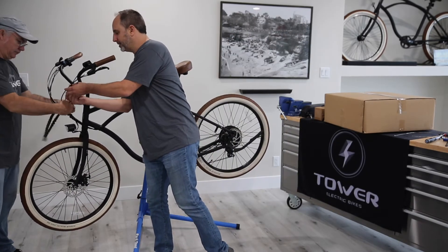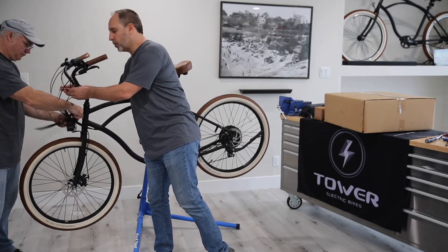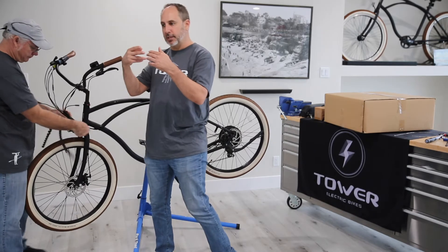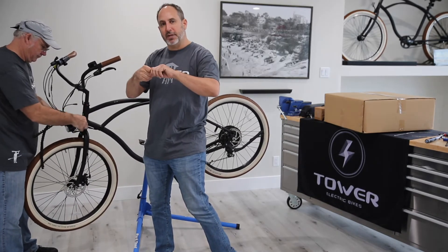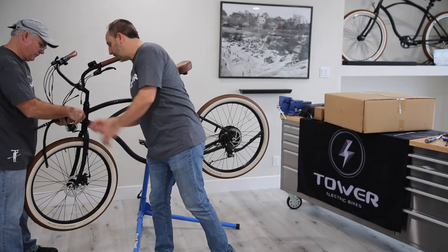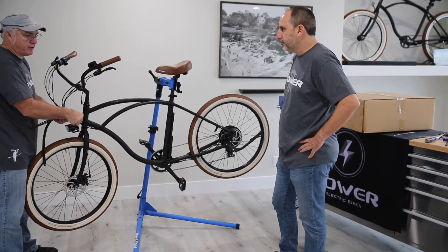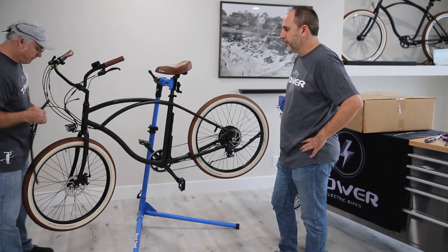What he's unwrapping here — you've got two connections on either side, so four total connections. These are kind of tricky connections when you look at them closely. There are little arrows you've got to line them up with, and there are little prongs you've got to get perfectly seated. It's not totally intuitive how to do that. It is important to line up the arrows whenever you're reconnecting connections at all points of the bike.